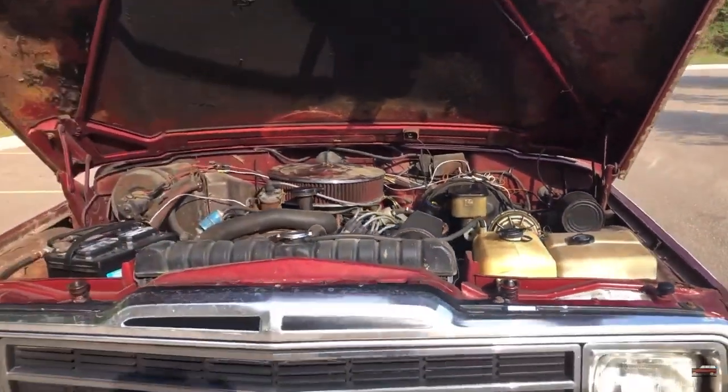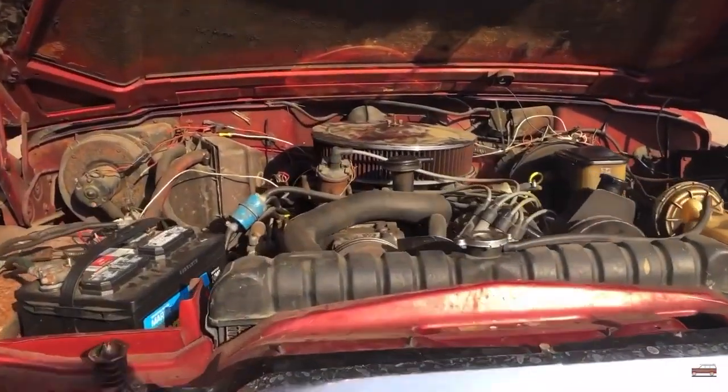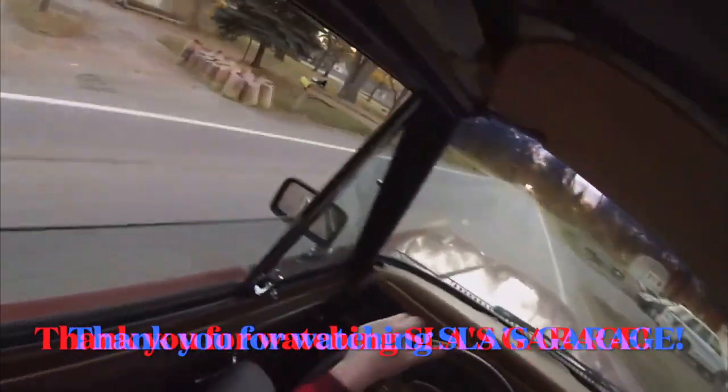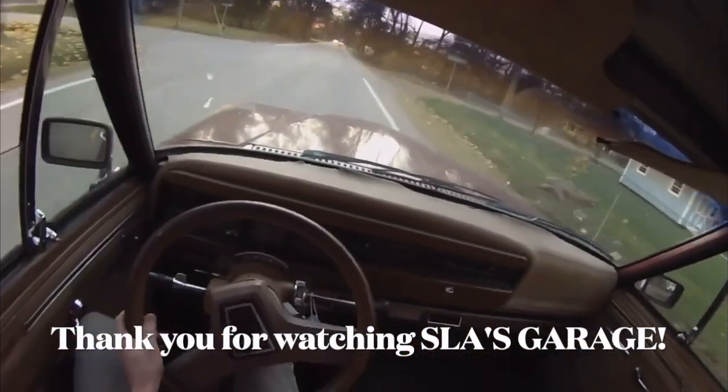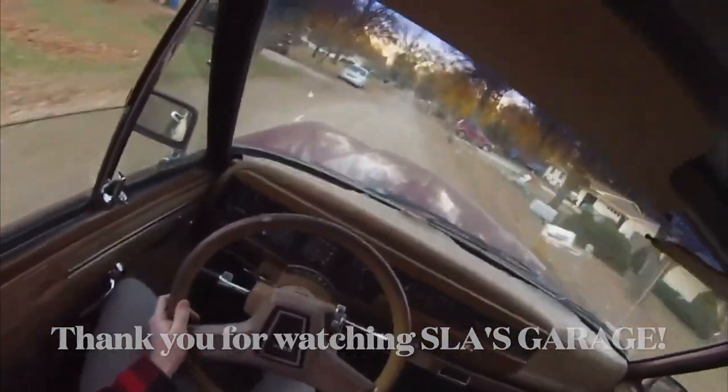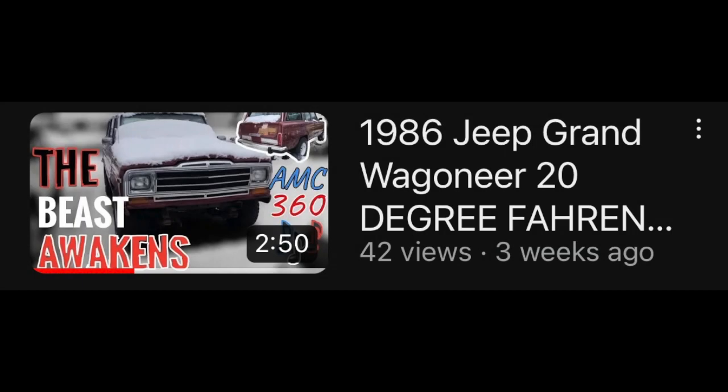One last thing — I need a hose that connects from here to here, that little C-shaped hose. But anyway, she's looking good and should run better since now she'll be able to breathe. All I had before was an air filter sitting on top with a plate on the bottom, just taking in warm air off the engine. Now she'll be able to breathe properly thanks to this hose and a proper air filter. If you made it to the end, thank you so much. Please give me some feedback, like the video, check out the channel, and subscribe if you're interested in seeing more Jeep Grand Wagoneer videos. Take care and hopefully see you in the next one.